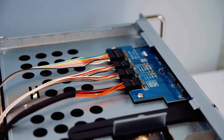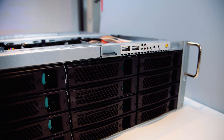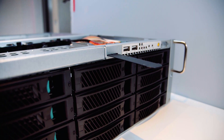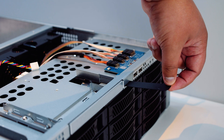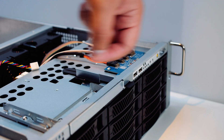It has a distribution board at the front where everything plugs in — showing network activity, hard disk activity, and where the USB headers connect. On the front of the case, there's an ID tag slash service tag. This is really helpful if your server is racked in a data center and you need to identify it, since you might have 10 of these in a single rack and need to know the IP address. It's just a little plastic tab you can pull out and push back in — very handy.